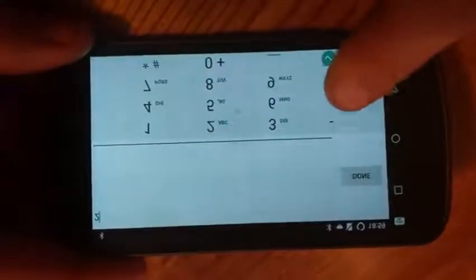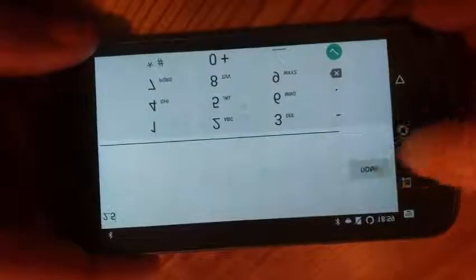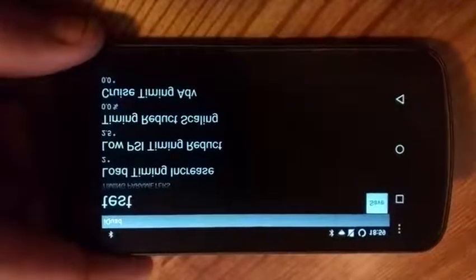So down low in the throttle position, if I'm cruising along and then I hit the throttle, low boost, it'll actually pull 2.5 degrees of timing. That should assist with turbo spool up depending on your situation.